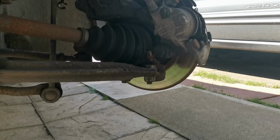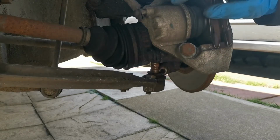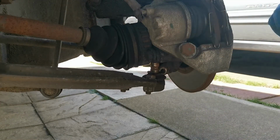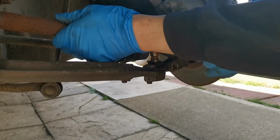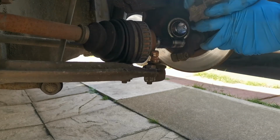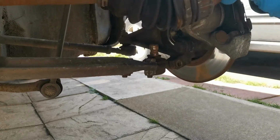So what we'll do is we will reposition and we'll get the drive shaft pulled out. I said about repositioning, but actually I think this ain't a bad position for the recording of what I'm about to do. I've turned the steering wheel in the car so the steering is full right hand down, pointing that way basically, so that gives me more play and more space to maneuver the leg out the way, and I can just push that out the way,